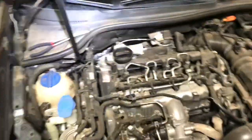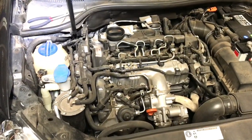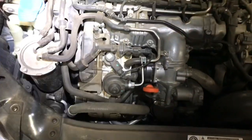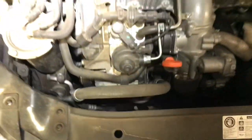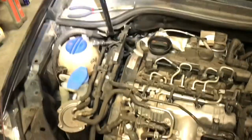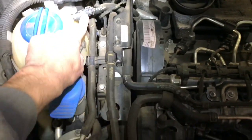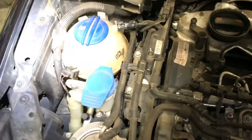I've got to do a coolant flush on this 2012 Jetta Sport Wagon TDI. I've seen some videos on YouTube of people disconnecting the lower radiator hose and doing a coolant flush that way, but I noticed something in a Humble Mechanic video where he said in passing that this hose at the top of your coolant tank is the return hose and that coolant is always cycling through the system — which is totally different than any other car I've worked on.